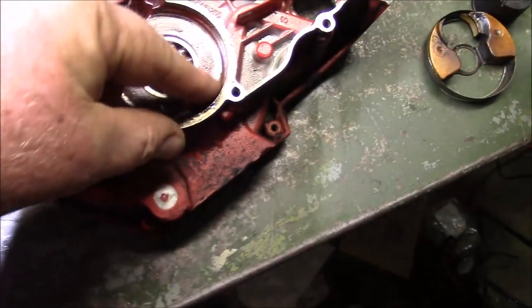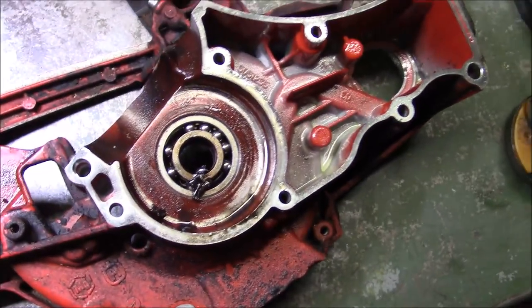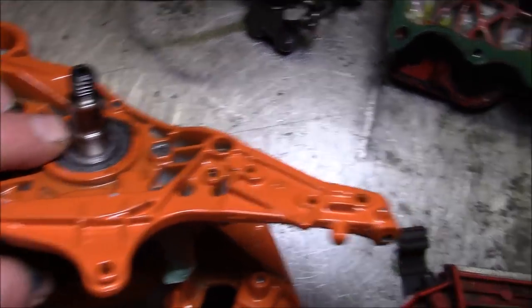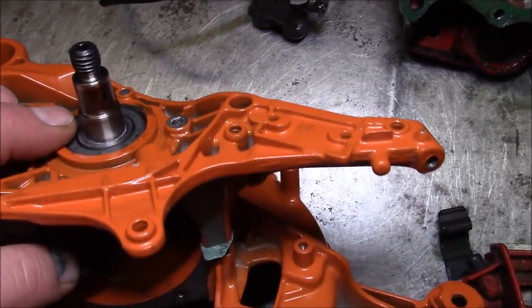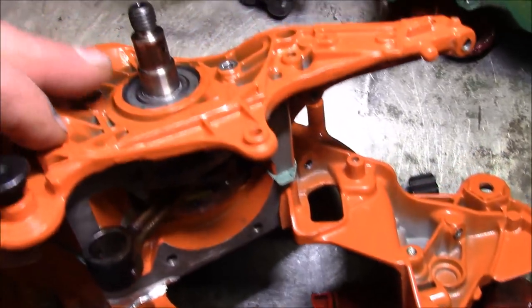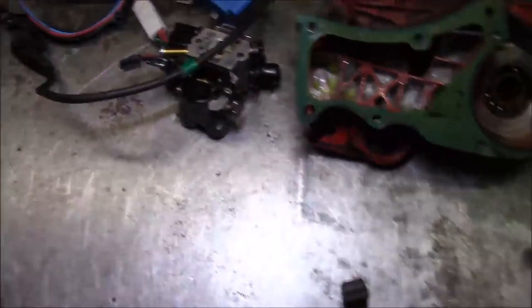If you look at those bearings carefully on both sides — look at that junk right there. If you've been following my channel you know exactly what it is. The problem with this crank is the diameter on the PTO side is too small. It slid right out of that case from the cracking eggs video and slid right into this one — no interference at all. There wasn't a lot of slop, but that thing has to be an interference fit, it can't be a slip fit. If I leave it, that crank starts rattling and will ruin the bearing and case. So I'm on the lookout for a better crank.